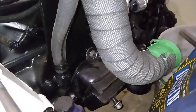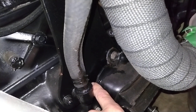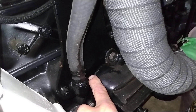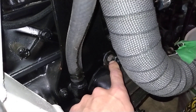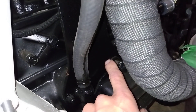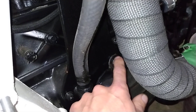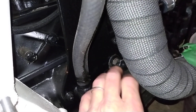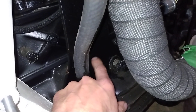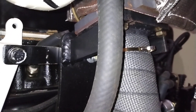Basically I built a plate that bolts to the fuel pump location — it's hard to see — so the oil return from the turbo goes where the mechanical fuel pump would have been. That also lines up near perfectly with the top engine mount, so that plate is supported in those two holes, keeping the plate nice and rigid. To accommodate the quarter-inch thickness of the plate on the engine mount, I cut that tab out, put the engine mount on, tack-welded it, pulled it off, and rewelded it — so that tab is actually a quarter inch farther out. Up top it's just some bracketing and bracing welded to the T4 flange.